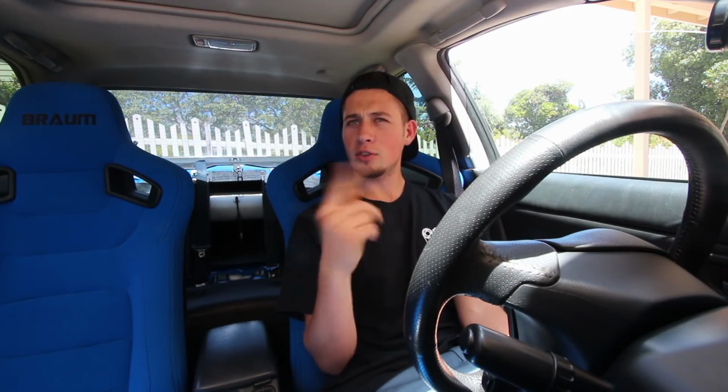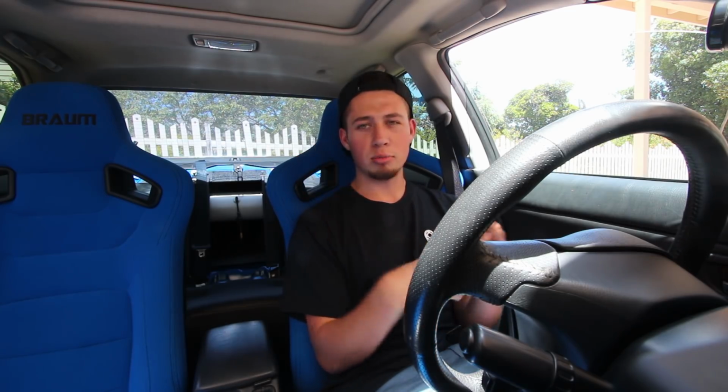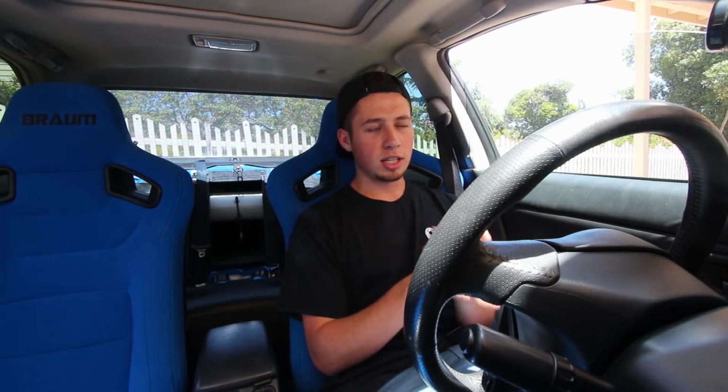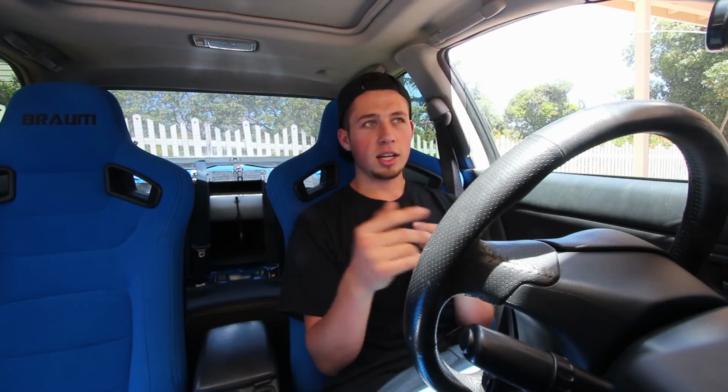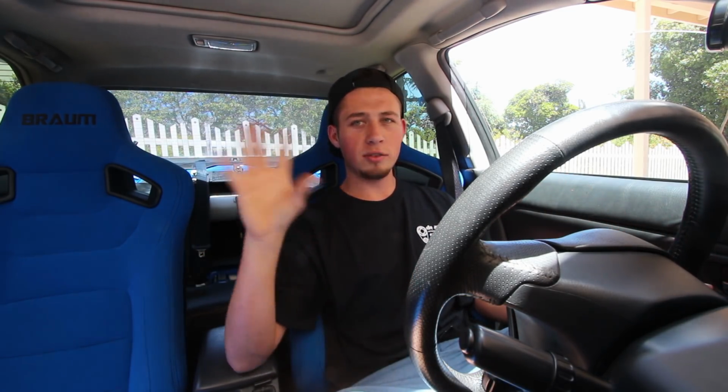Now that I think about it, I don't even know if I said in my last video I found out the problem. My problem isn't a fuel problem, it's not a vacuum problem, it's not a spark problem, it's none of that. It's actually that I was running too much advance. I data logged a bunch of stuff. I felt like a legit tuner for a little bit. I data logged a bunch of stuff, looking at all my parameters, and everything looked good.